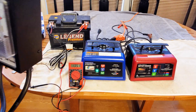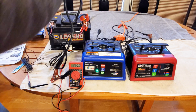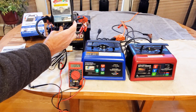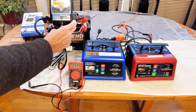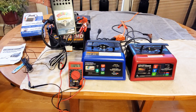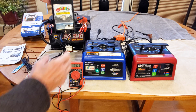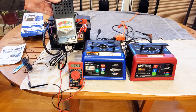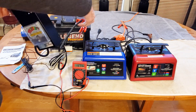Here is a battery tester that's going to act like our starter — it puts a 100 amp draw on the battery and chargers, just like a starter engaging. In 2 amp mode the gauge sits in the 2 amp area, but hitting the starter jumped it to 15 amp output without even being in start mode. In 10 amp mode and engaging the starter we get the full 50 amps again without being in start mode. In start mode it acts just like the red charger — the needle goes back and forth waiting to see the starter engage, and when we engage it we get the full 50 amps. Starter engagement and the 50 amp output work the same in both regular and AGM mode.